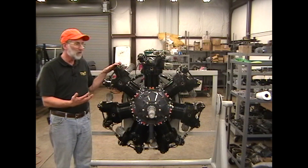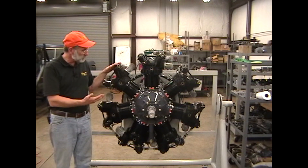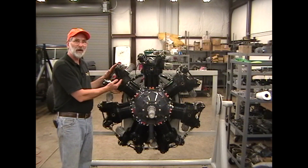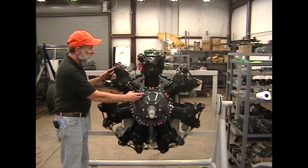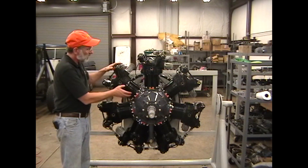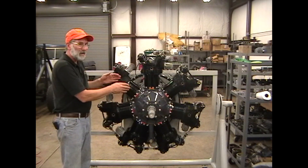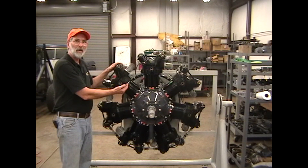The first thing we want to do in preparing to remove a cylinder is make sure that whatever cylinder we're working on, the piston is at top dead center. Let's say we're going to remove the number two cylinder — we want to make sure the piston has traveled all the way to the top of its travel. When we pull the cylinder off, we don't want the piston to be down inside the case, which at bottom dead center it actually is, by a couple of inches. We want it up at the top so that when the rings come out, they don't come out inside the case, because then it gets complicated getting the piston out without breaking something.